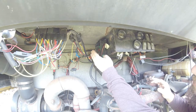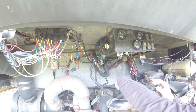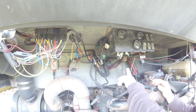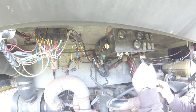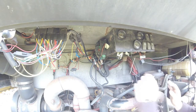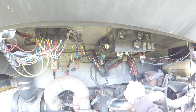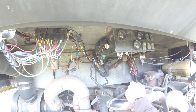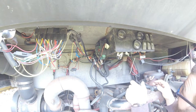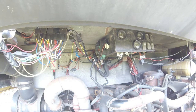Then you have what's referred to as the VEC attached to the side — the Vehicle Electrical Center. In the previous video I may have mixed those up, but that's the VEC and this is the rear electrical box. There is also a diagnostic connector off to the side, which is kind of neat. Those things are scattered all over this vehicle — you can plug in from virtually anywhere on this bus with a scan tool.